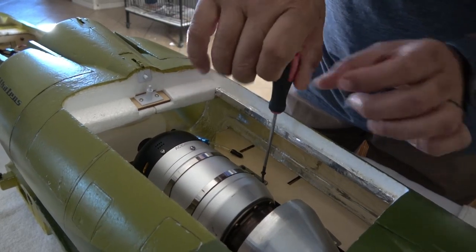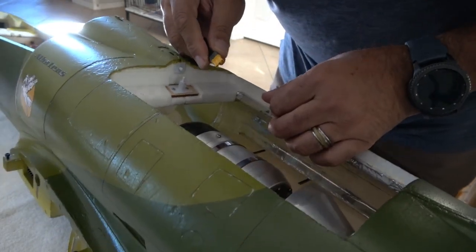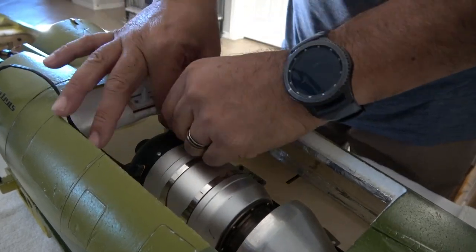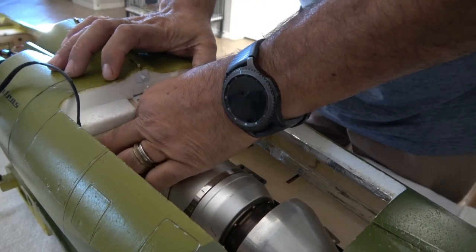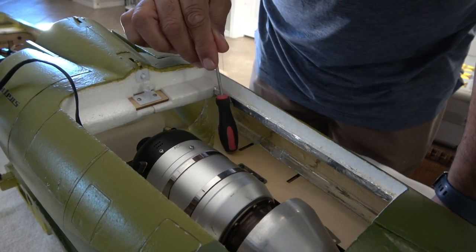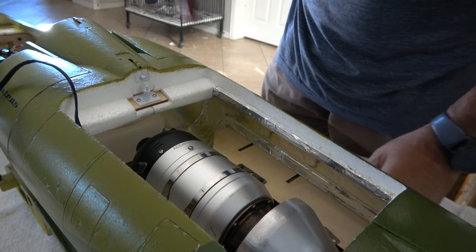Once the screws are in, we begin our electrical and fuel connection. All screws are in there. I'm going to go ahead and connect the cable. Normally I run it under the tray to make it look neat, but right now for installation purposes I'm just going to run it through the side here. I'm going to plug in my fuel connection. A lot of people install the fuel pump in the engine compartment — that's fine, just keep it where none of the fuel lines are touching the casing. Because I'm using small batteries, my fuel pump is going to go in the front.